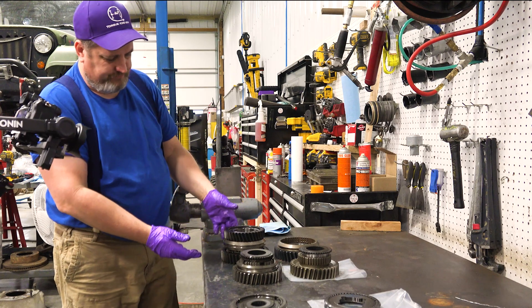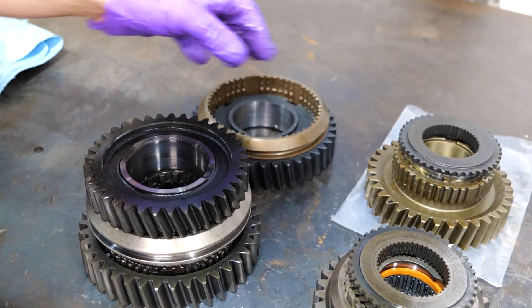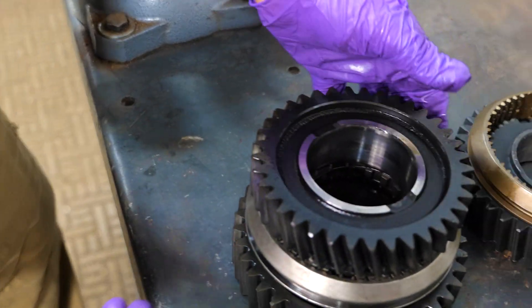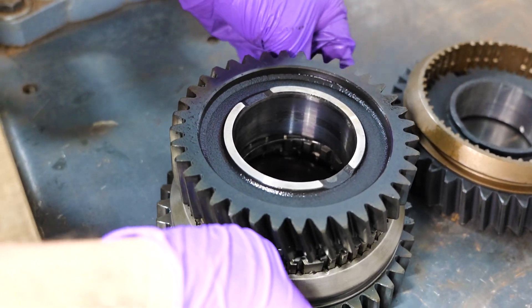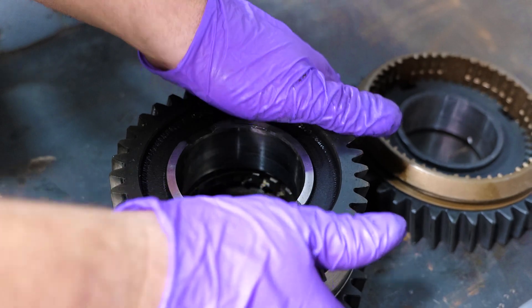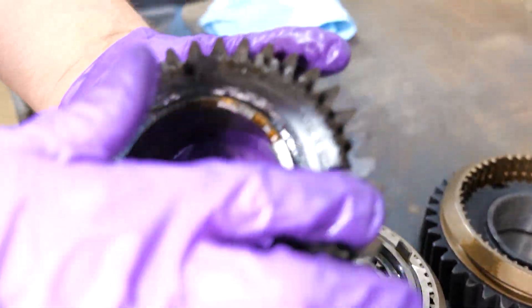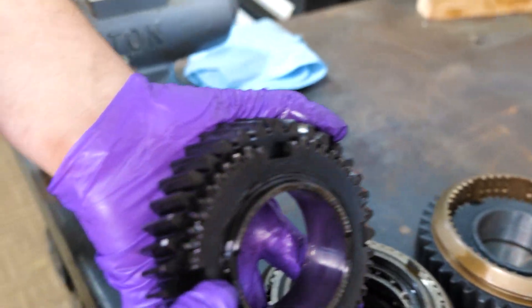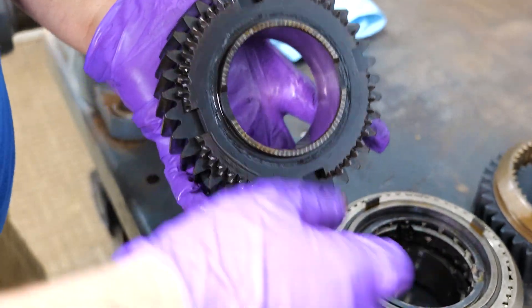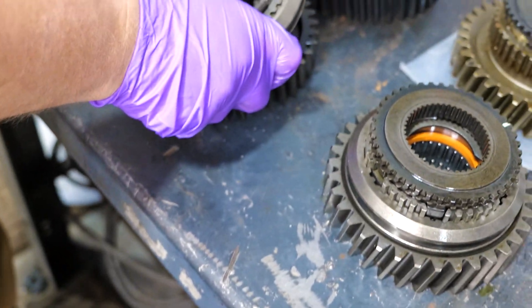Lastly, we've got our first and second gear. My first gear here, second gear here — there's a brand new first gear and a brand new shift collar. You can hear there's just a tiny bit of play on that one, just like there is on that one. It looks like more, but that's not any more play. Engaged — it's the same way. That's fully engaged in first, and that's fully engaged in second. We've got good sharp corners to a nice point there, and that's what the synchro and collar all need to line up. So I'm not going to take that apart much further — we've looked at that a couple of times.